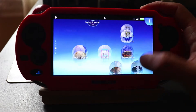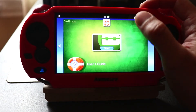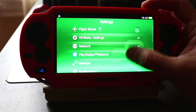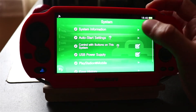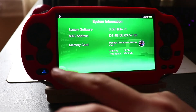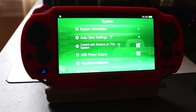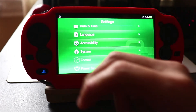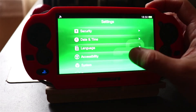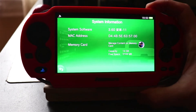This tutorial is mainly for higher gigabyte SD cards — 256 gigabytes and upwards — where you have to install SD to Vita manually rather than relying on the auto plugin. Because we're using a larger SD card, we need to edit some config files in VitaShell. First, make sure your PS Vita or PSTV is running the Enso exploit on firmware 3.60 or 3.65. I'm running 3.60 with Enso as my custom firmware.